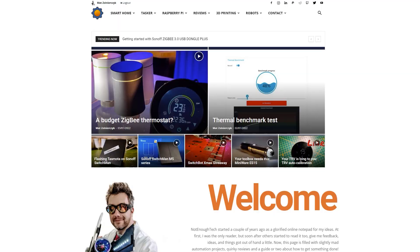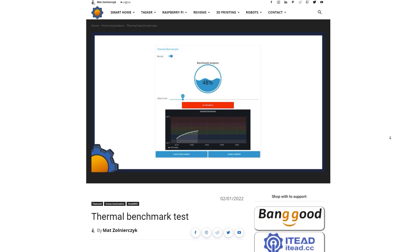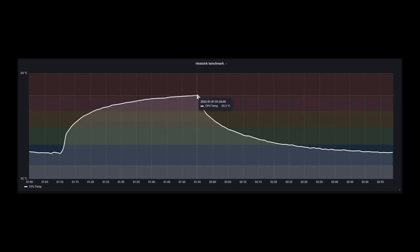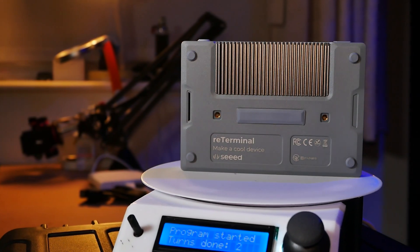You can scale up the interface so everything on screen is more touch-friendly. The first benchmark I ran was cooling, thanks to the fully passive heatsink on the back. I had to run a stress benchmark for 45 minutes before saturating the heat dissipation rate. Running at 20°C indoors, it topped out at 55°C after 45 minutes. However, it took around 40 minutes to cool the heatsink back down to ambient, sitting at around 35°C at idle. That's not a massive surprise — it's a big chunk of metal that stores a lot of heat, great for short-term cooling but slower to fully dissipate.